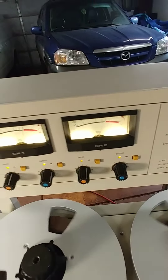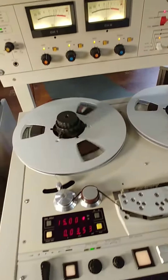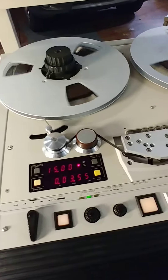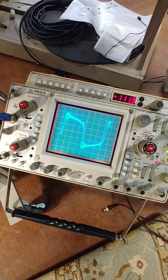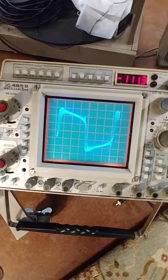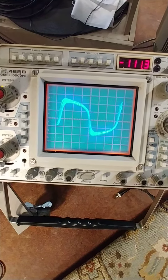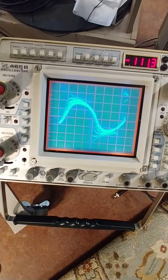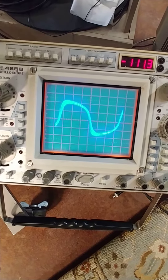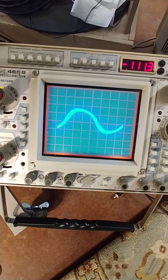The other one's rock-solid — a little bit of a waver is anything but fine. It's pulling tape, which is not good. If you get a scope on the situation you can see it; this is what the waveform looks like. If I disengage the impedance roller, see what it does — you're hearing the effect of it.